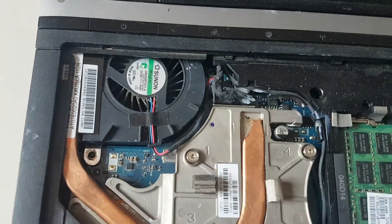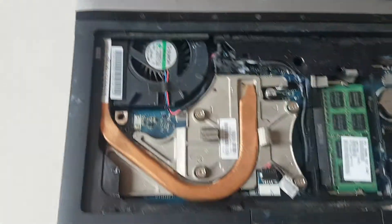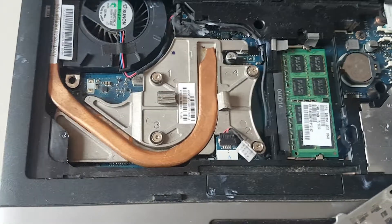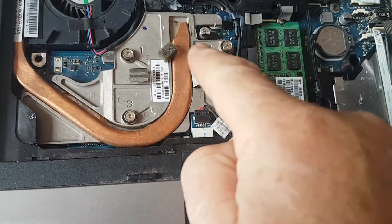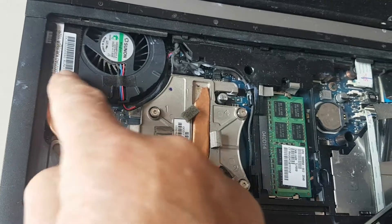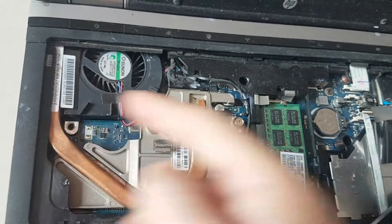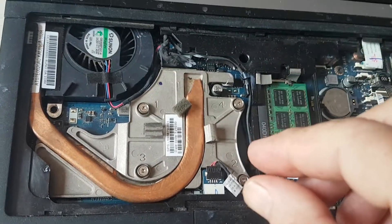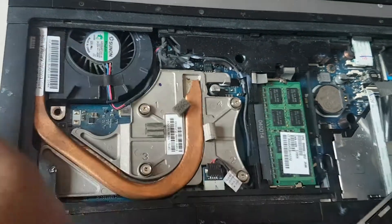As I say, this machine is sadly dead and I think it's beyond economic repair. I want to point out how to change the CPU. Here we have the main heat sink with the copper heat path — a heat pipe going up to the fan assembly. There's a very small radiator in there with very, very narrow slots, lots of them. The fan sucks in from about six individual places on the machine and directs the output through this radiator and out.